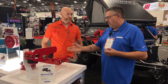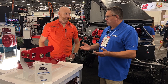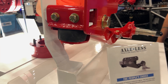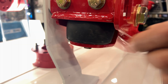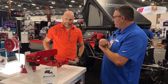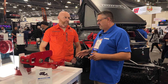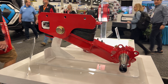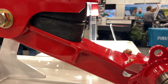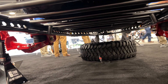As the suspension actuates, the jounce spring absorbs the energy. All the energy comes up, and when it's released, there's a rebound spring in the front that absorbs that energy. So it's a push-pull setup — pretty much a push-pull setup. Very great ride quality, second only to an air ride. What you gain is total ground clearance under your trailer, and then a nice, supple ride.